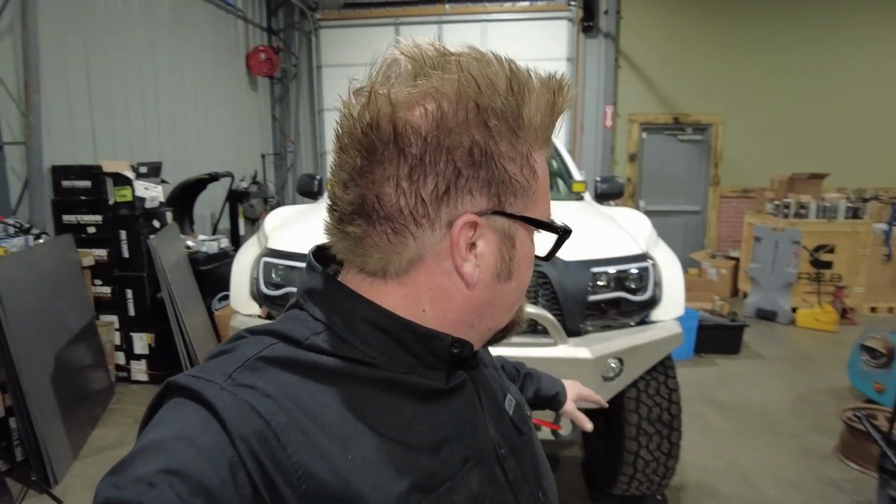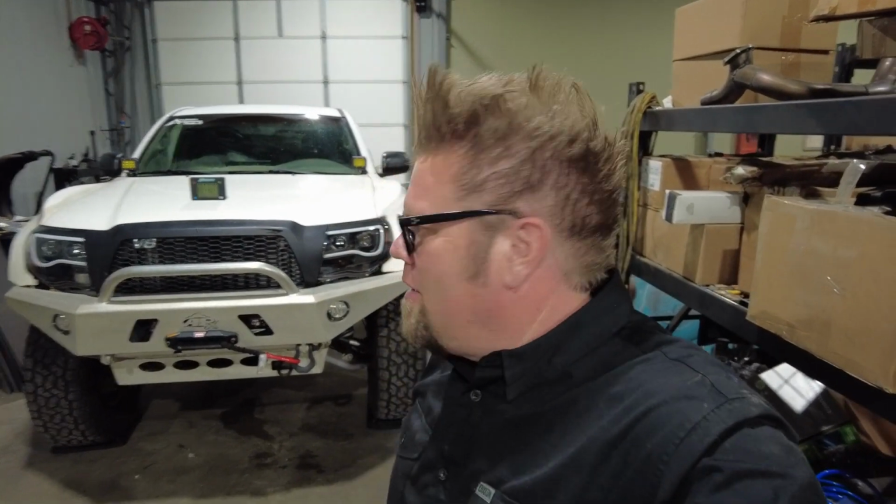Basically what I do is I lift the front up, adjust those collars, probably drop the front right down maybe ½ inch, pick the front left up maybe ½ inch, see what that does. I like to even that out, but you don't notice it when you drive it, to be honest with you, so I don't really know what's going on there. That might take a little bit of further investigation, but that's not bad. Under 4,000 pounds for a V8 powered pickup truck.